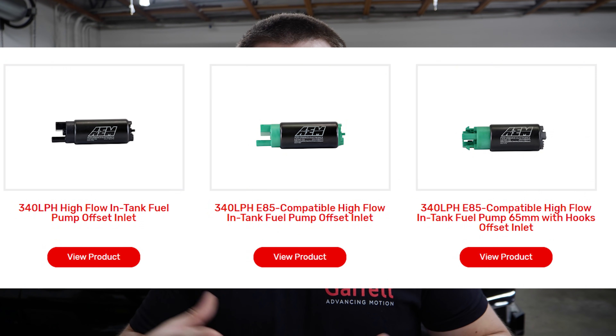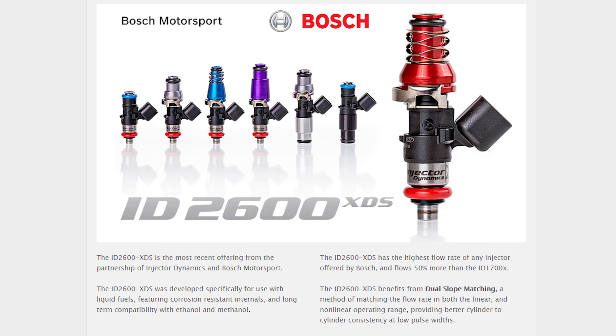The long term problems make sense. E85 is an alcohol — it is very corrosive. It's very dangerous to use on a vehicle that's not designed with the correct hoses, the correct pumps, the correct injectors. It'll gum them up, cause problems, eat through certain seals, plastics, and whatnot. You have to have your whole fuel system capable of handling the fuel itself. I doubt you would make it that long if you put ethanol into this car.